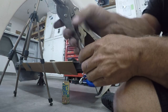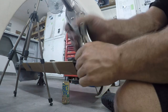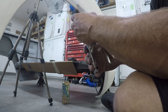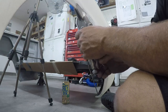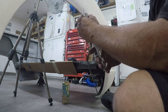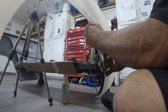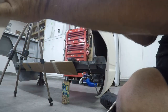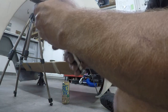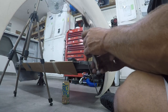It also lays the inside fender flat. For the most part you can do it without scratching the paint at all. All this right here is just dirt from the body hammer. So there you have it — that's how you roll fenders. The body line comes pretty much right back to where it was. I'll do a little bit more hammering off camera, but that's how you roll fenders.